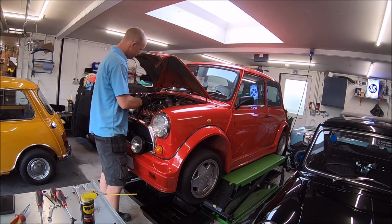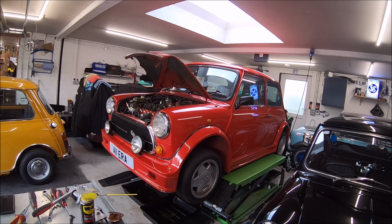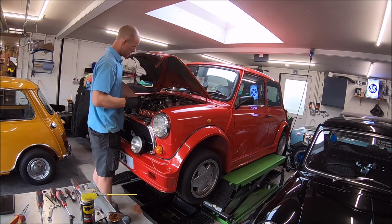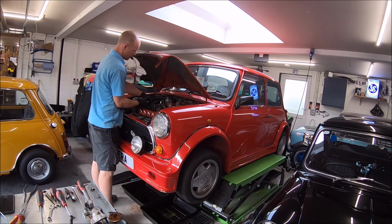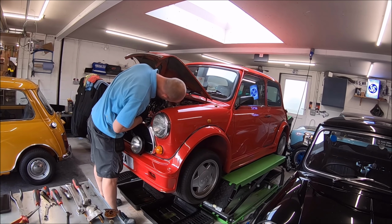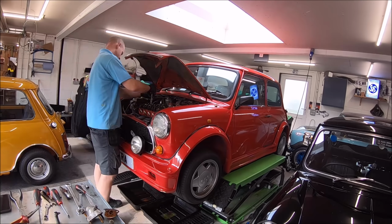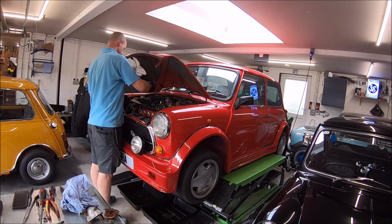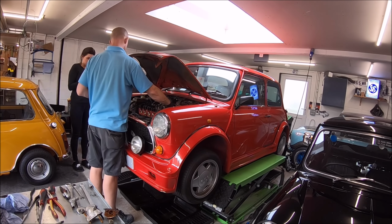Unfortunately, he took it on the London to Brighton mini run, and it started to run noticeably hot, and then lost some coolant out the header tank, and then Mark noticed some emulsification of the oil, so water mixed with the oil in the rocker cover. Now that is not uncommon if a car's not used and it's laid out in a damp environment, but Phil, the ERA, is always kept in a warm heated garage, so it's a little bit unusual. So those are the alarm bells ringing straight away.